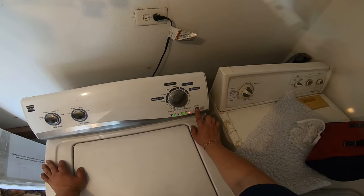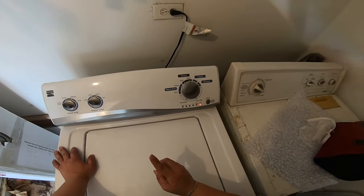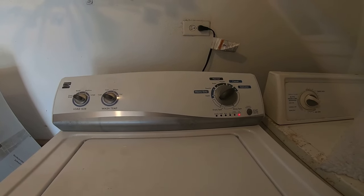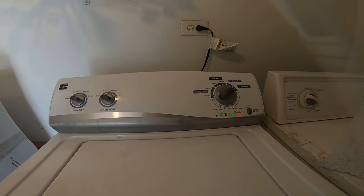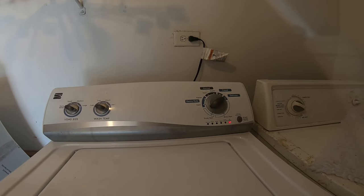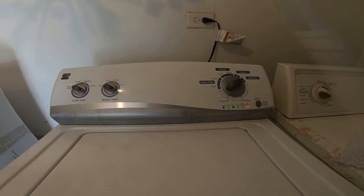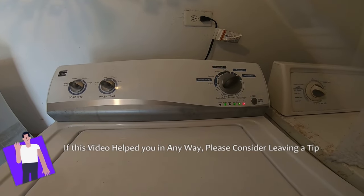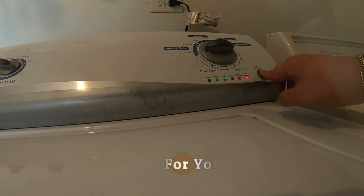And this is the agitation. So when you press it, it will flash like that, but the drum has to stop spinning. That way it changes to agitation. So we gotta wait until it stops spinning. Now I can hear where the drum is about to stop, and then it's gonna make another clicking noise, which should be the actuator. And it's gonna begin doing the agitation. I already can hear the actuator making those clicking noises. And you can hear this, that's a low agitation, and this is high agitation.